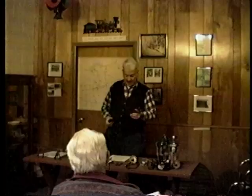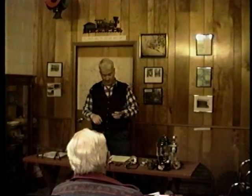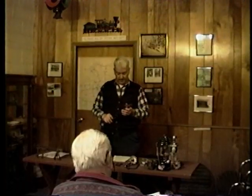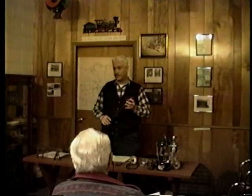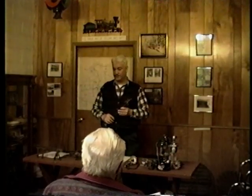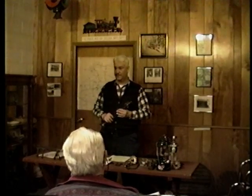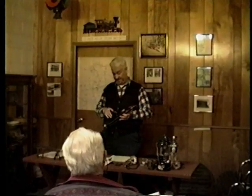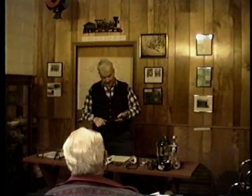And if this happened to you, and you had no idea what was going on, all you really had to do was come out and touch this thing, because normally this was pretty cool. The top of it was closed to the water when it was full of water, and it didn't have water circulating through it, so it was pretty cool. And as soon as it filled with steam, it got just the opposite, pretty hot. And if you touched it or spritzed some water on it, you'd pretty well know it had closed.